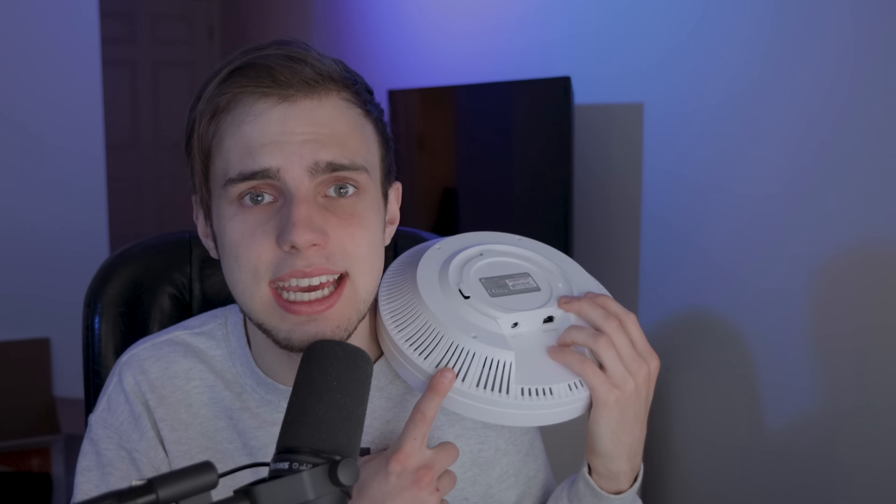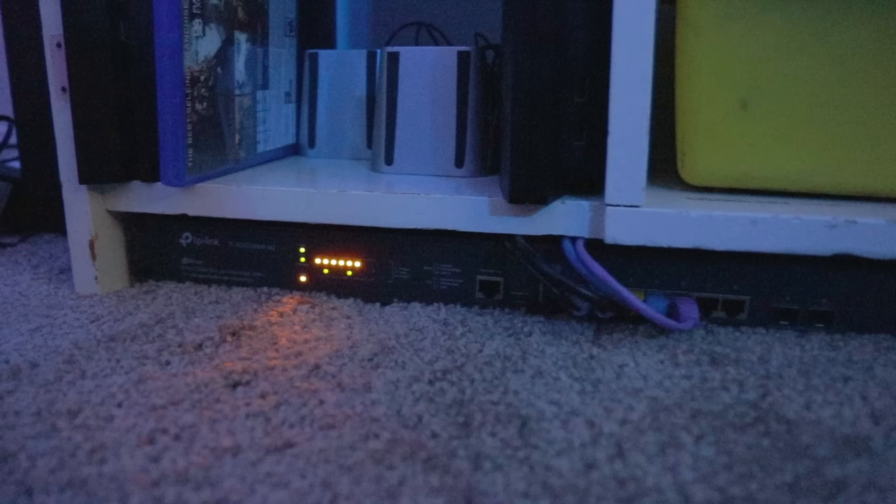Great in terms of options. In terms of overall performance, I'll have some more videos coming out in the near future about the performance of the access points and the switches. But overall, I have no complaints about performance. This access point is a freaking monster and outperforms the U6LR. It's able to do that because it has a two-and-a-half-gig network jack on it, and I have a two-and-a-half-gig switch from them. That two-and-a-half-gig port is really what allows it to beat the U6LR, because the U6LR outperforms it in terms of single-client performance. But as soon as you connect a second client, you're saturating the gigabit port on the U6LR, and this one has two and a half gigs — so it pulls off with a win.